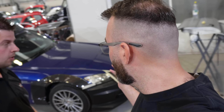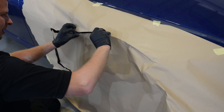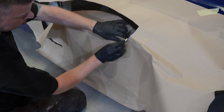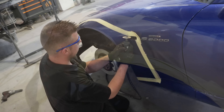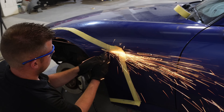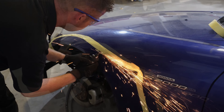It's day two, we're back again with the S2000 — got a bit late last night, out at 11 I think. So we're on to arch number two at the front, and then number three and four at the back. Because we've already fitted the driver's side arch, we're just going to take a template from this side, reverse it, and put it on the other. This will save us some time, and because it's a race car, we don't even need to be gentle. With our template on the other side, it's time to start cutting. This time we've got the pneumatic grinder and plenty of new wheels, and they're cutting through the panels much quicker.